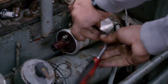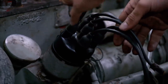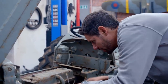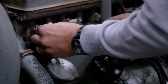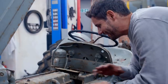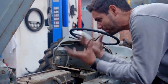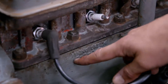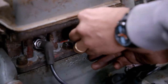I retraced my steps to put the engine back together — just the high-tension leads to go. Getting the firing order correct and getting these leads connected up in the right order is really important, because the engine pushes its pistons up and down in a particular order, and so the spark needs to be delivered to that cylinder at exactly the right moment. If you get it wrong it'll be chaos — there'll be flames coming out of the exhaust, sparks when we don't need them, fuel being compressed but not ignited, and it just won't work. Quite luckily, on this old engine, the firing order is imprinted on the side of the block, which is very handy.